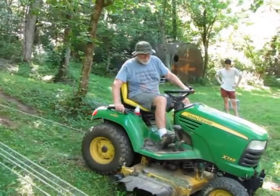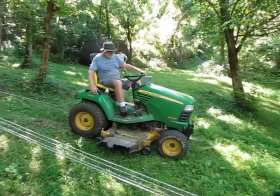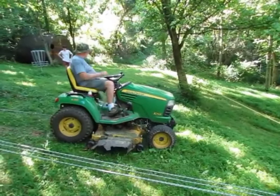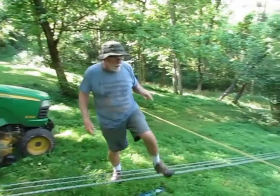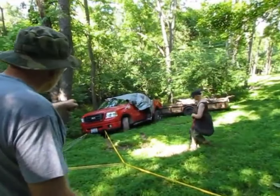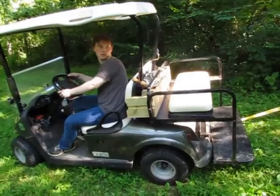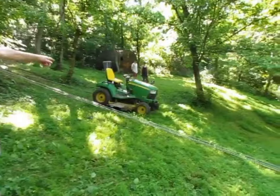Just going to get up just a little bit to see what happens — okay, those weak links are fine. The mower is sort of idling, just holding itself there. I'm going to load it a little bit more and notice the other rope is starting to go slack — I'm actually moving the truck. Now I'm going to stop here. Okay, we're loading up this other rope now — stop. We've got good tension on that and good tension on that. It's time to do the job.